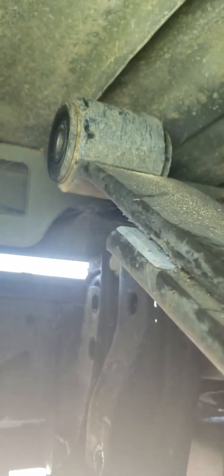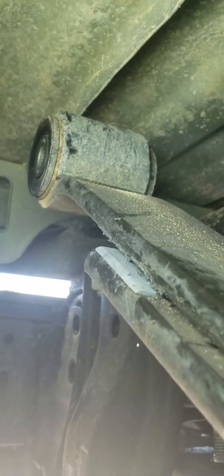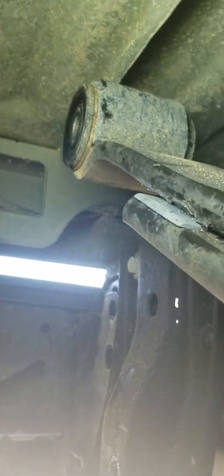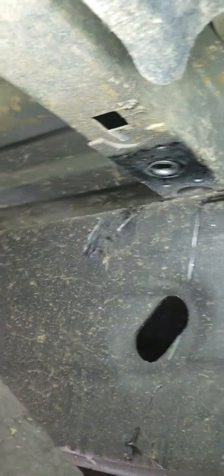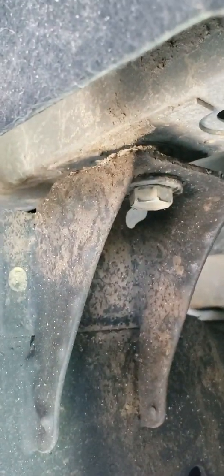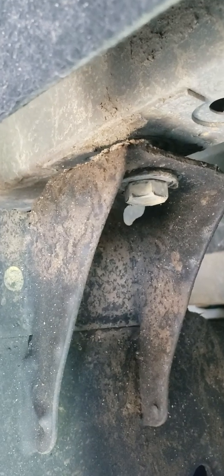As you can see on this side already, the spring is still here and I had that one shackle out already, just by lifting the bed just that little bit to get that little bit of clearance. Do two bolts in the rear, one bolt in the front. Just lift it up far enough to make clearance on that top bolt on the spring and you should be doing good.